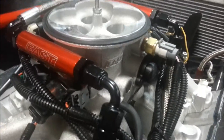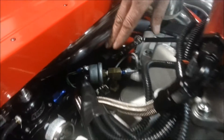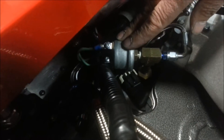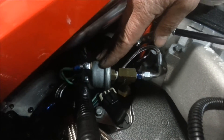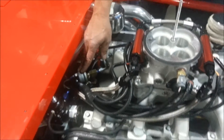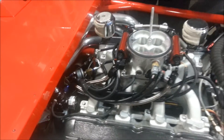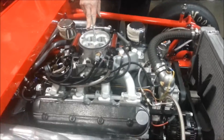One of the special things about having the electric fuel pump is we've got an oil pressure shutoff switch here, which goes to the fuel pump in case of an accident — it will shut that fuel off. So it's very, very safe. People get concerned about it, but tech officials will need to check and make sure that this is functional and operating for all of our safety.